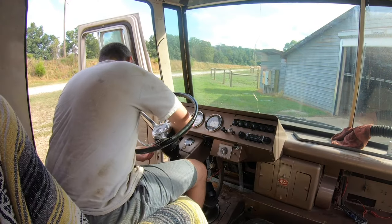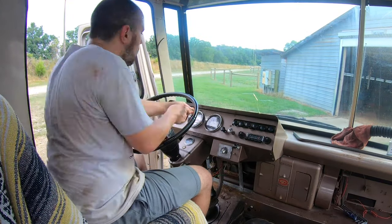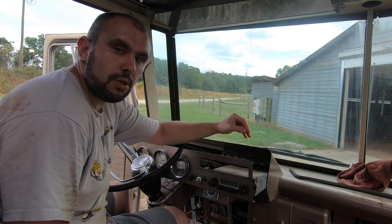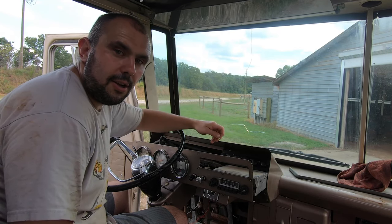We've got one wire left and that's the white 12-volt feed for the gauge light. To get that hooked up, I'm going to take the front panel of the dash out and find somewhere suitable to connect it. I found a suitable connection point, tested it and it all works. So I'm just going to put a new spade end on the white wire and get it all connected up.